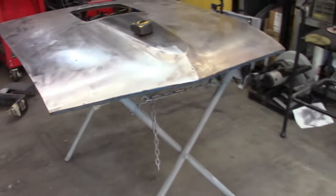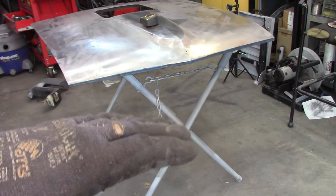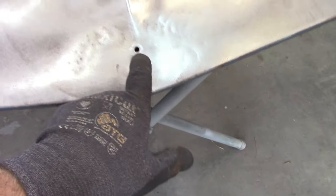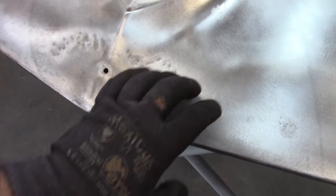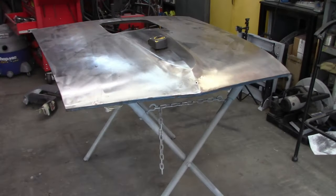A little clarification - I did drill the hole, not very big. It was actually 44 and 5 eighths, not 7 eighths from the back when I squared everything up, and it was still 14 and a quarter from center line to the hole. You could also bring the hood down with pins installed, push down on them with marker to indicate where they actually go. There are a few things I still need to do to this: there's some damage up here, I'll probably have to weld shut that hole, and some of these dents I can't do anything about - they're inside with no access. Just a little bit of filler will take care of that. Otherwise it's a good hood, just got to doctor it up a little bit.